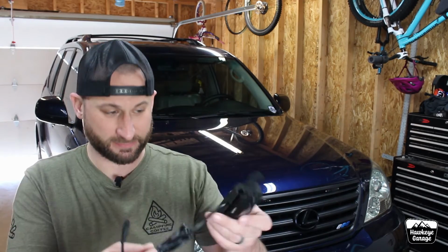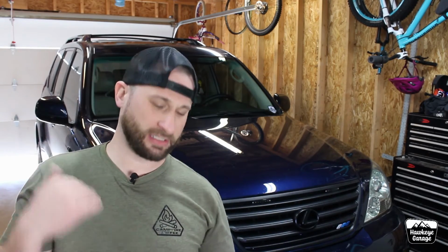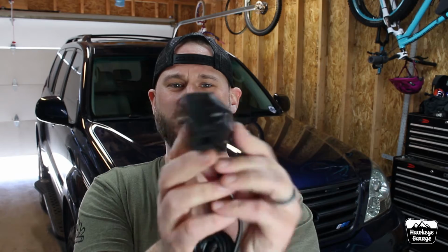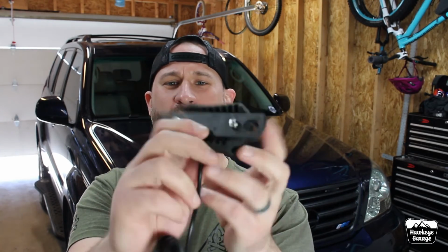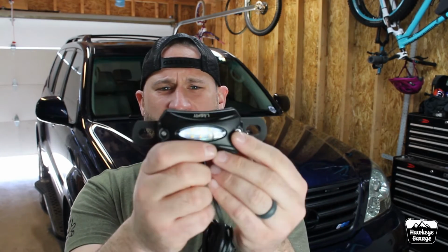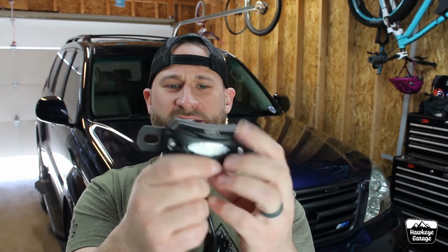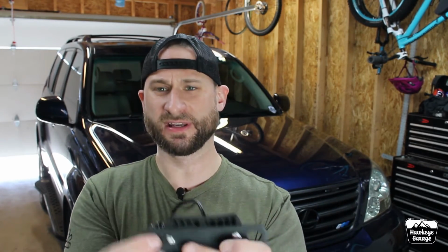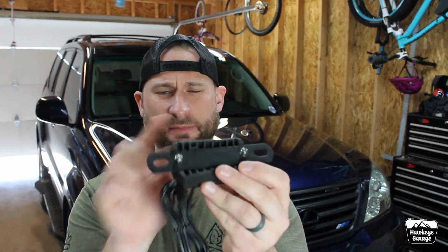All right, I've got the lights mounted on a couple different brackets. I figured I would show you guys how I've got them on the brackets before we crawl underneath and actually mount them to the car. For the fronts, I've just got these, what are they, like 5-inch brackets from the hardware store. Drilled a couple holes and mounted the light to it, ran the cord out through the gasket, of course, and then we'll bolt them onto the body with the existing holes in that bracket.